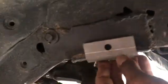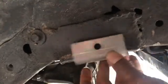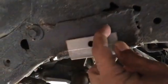And over here in the trunk, it had to be cut in order for the top of the shocks to stick out in that brace. So that's what we're going to be repairing. I've got to cut some angle iron, take some measurements, and basically this isn't what I'm going to use, but just to kind of show you, I'm going to re-weld it here and then reinforce it with more welds on top.